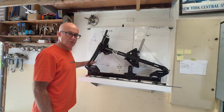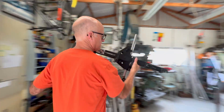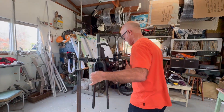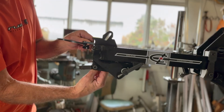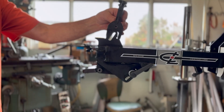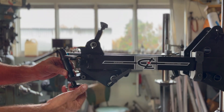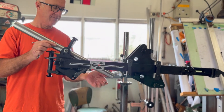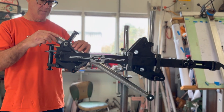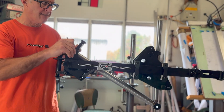We've got the frame jig set up with all the measurements. Let's go over and put it in the bike stand. Out with the forks and in with the down tube and head tube fixtures. This is where the centerline jig changes from a frame geometry tool to a tube fixture, setting up the down tube and head tube intersection. Just confirm the height at the front there and lock it up.